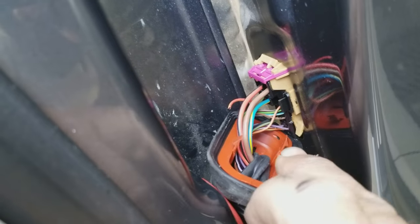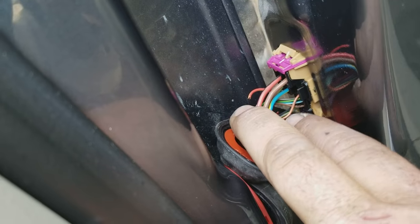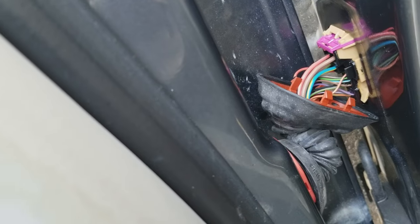If you break this boot away, you're going to find broken wires in the door. We got a red one right here as soon as I open it up. So what I'm going to do is release this harness, solder and heat shrink this wire back together, and that's going to eliminate the problems. These wires get really hard inside the rubber boot and they always break on the Audis.